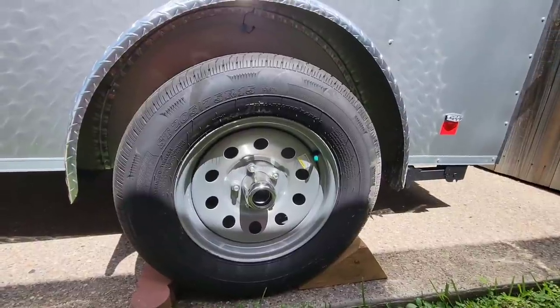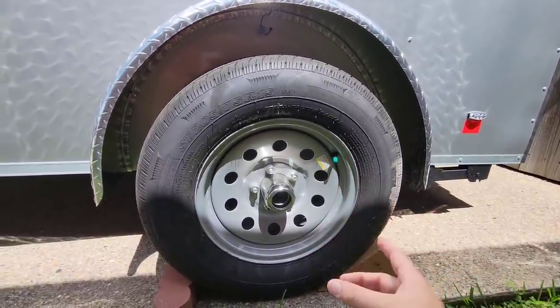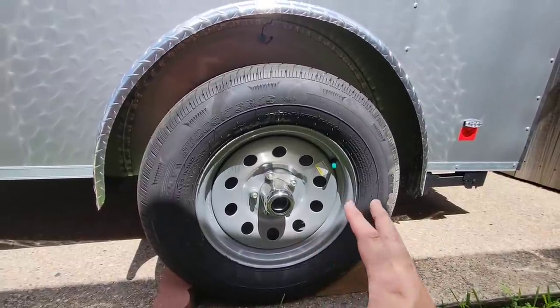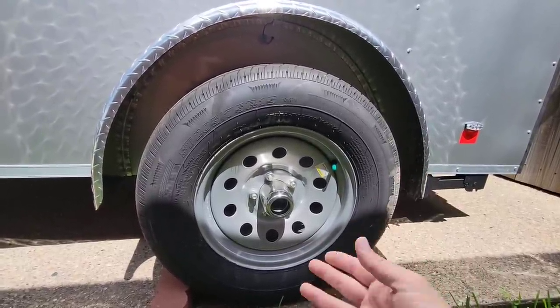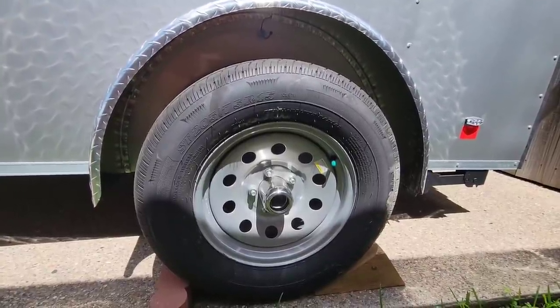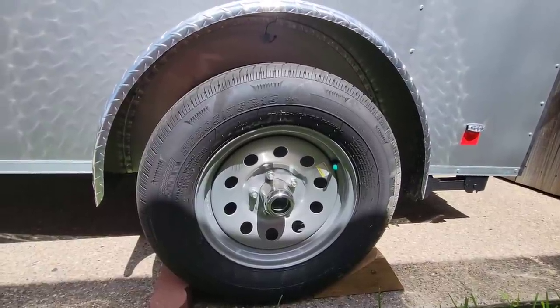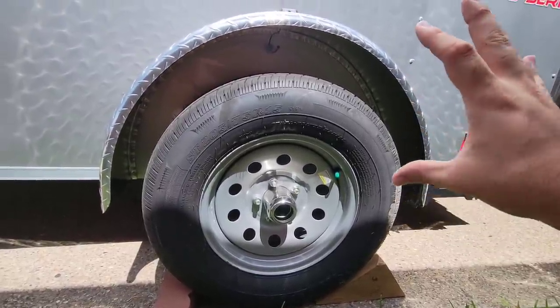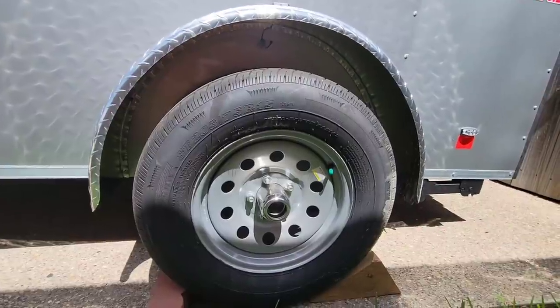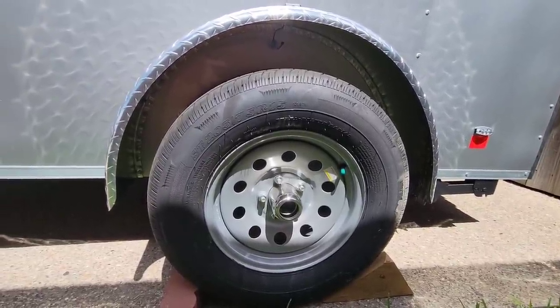This is a five by four-and-a-half inch lug pattern versus the six-lug pattern you see on a lot of travel trailers — so this is a really light-duty axle, rated at 3,500 pounds. The tires I'm putting on are rated at about 4,000 pounds each, so it's going to be a significant bump in the tire and wheel assembly. They're going to look a lot better and arguably last a lot longer.